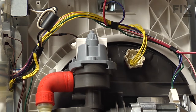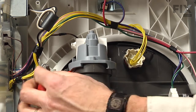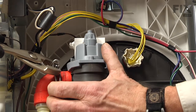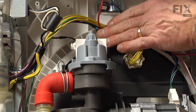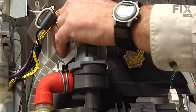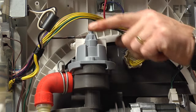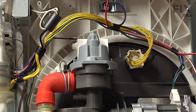Next, we will reinstall the clamp. The wire harness on the new pump motor has rotated that connection 90 degrees. There's lots of length in the wire leads so it will fit nicely. Simply line it up, snap it into position. The wires will point towards the center of the motor and the locking tab should engage. Now we're ready to stand the dishwasher back up and reconnect it.